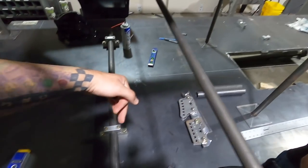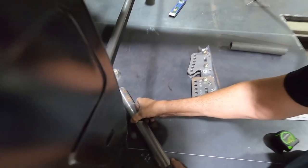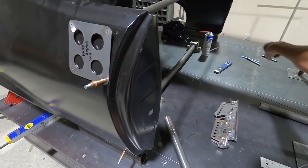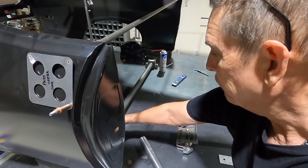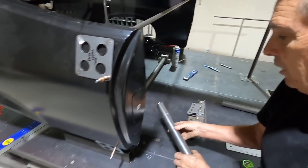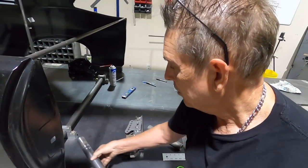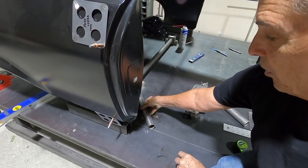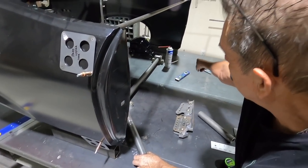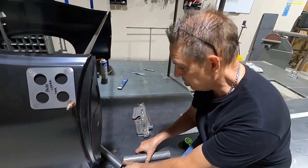This mark here is where the main hoop is going to go, which is 10 inches in front of that cross member. The main hoop will weld to that continuous bar, 10 inches in front of center of tube. You find your center of tube, these are up 10 inches, and since the hoop welds to this bar and not the other one, you make your angle so the tube runs to half the center of that tube, and when your hoop is 10 inches up over there, it'll be 10 inches up here, with the rocker panel notching in.